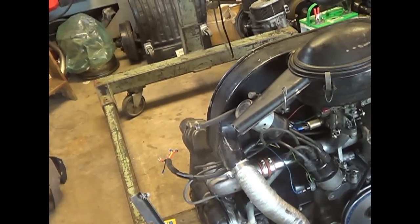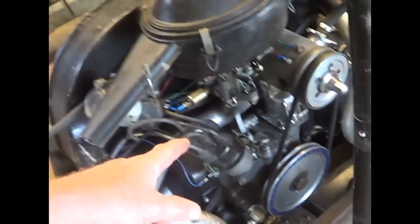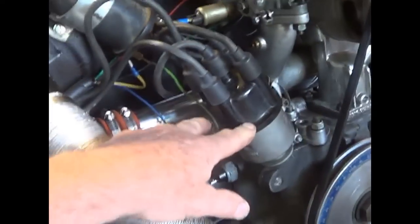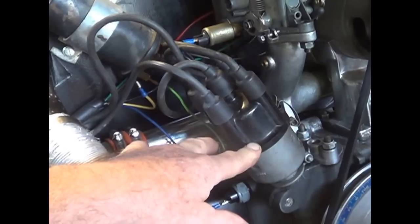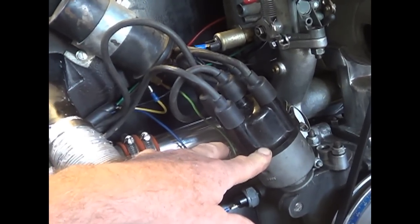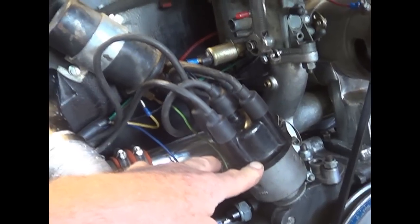It's only when they changed hands a dozen times and people with no money really started trying to engineer them themselves and keep them running. But they had a different carburetor, and a different distributor. Now, these 009 distributors work on motion, on RPM. As the RPM increases, it causes them to advance. The Volkswagen used various forms of distributors, one of which was vacuum and centrifugal.